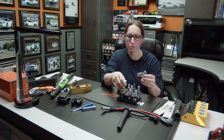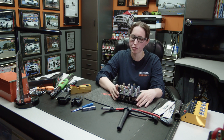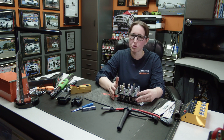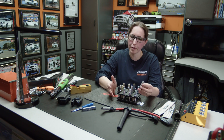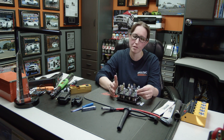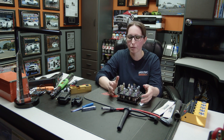When you go to get your car or engine tuned, or make modifications, gap is a huge factor. Spark plug gap depends on how much boost you're running, nitrous, or even naturally aspirated. Some people like to run a bigger gap, some smaller. If cylinder pressures are high, you typically need a slightly shorter gap. The more power you make, the shorter it has to be, though in most applications you want it as big as you reasonably can.